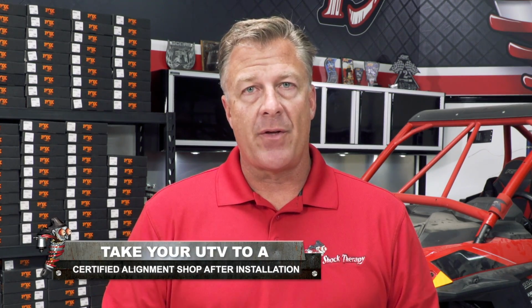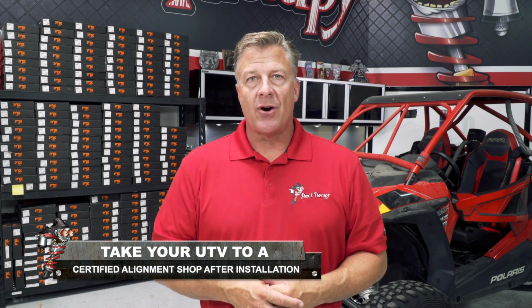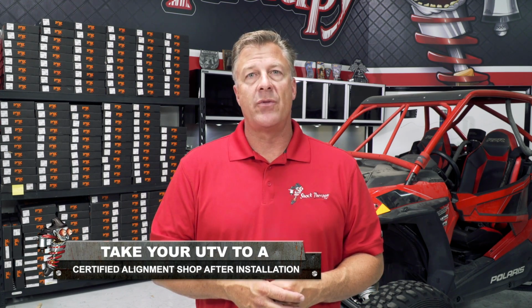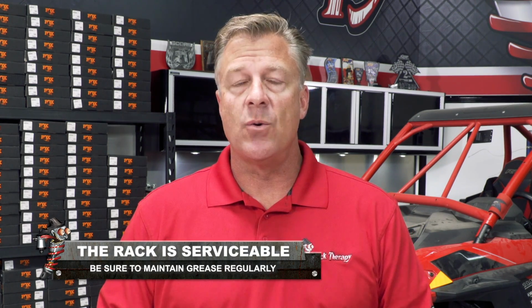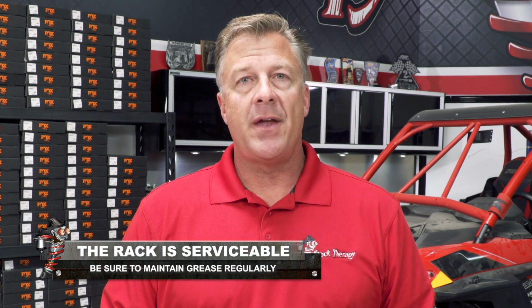Even though Mitch showed you how to do a rough alignment on the car, we always recommend that you take your car to a professional alignment shop to make sure that it's perfect. One final thing that we want you to be aware of: never remove the rod ends from the end of the rack gears the way we ship them. We find that it's common people take the clevis on their tie rod kit and switch it around with the rod end that's in the rack. Never do this, as it changes the geometry in the front end and will create bump steer.